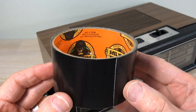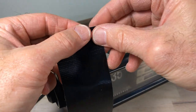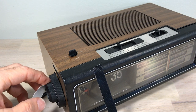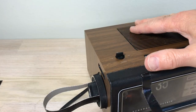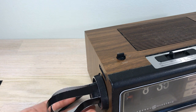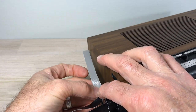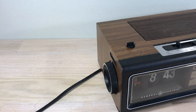I've had a video about this before — we used gorilla tape. I'm still a fan of gorilla tape; you can use T-Rex tape or something a little stronger than plain duct tape. Be careful where you stick this — you don't want to stick it on that chrome stripe, it could take that stripe off. Put it on your knob, give it a good squeeze for good contact, wrap it well, and then just pull straight away. It doesn't take that much force — it works.